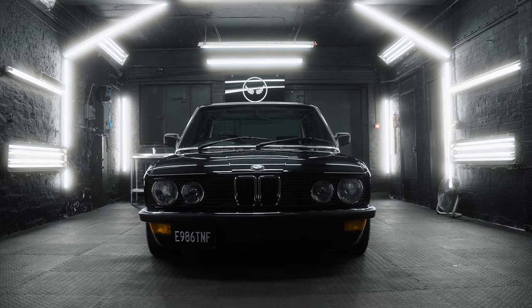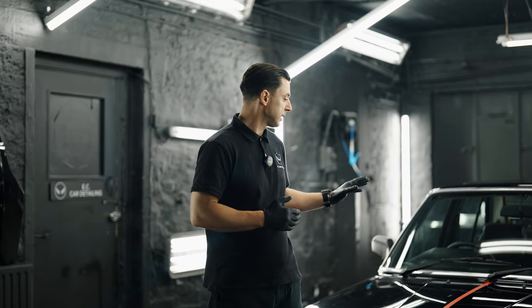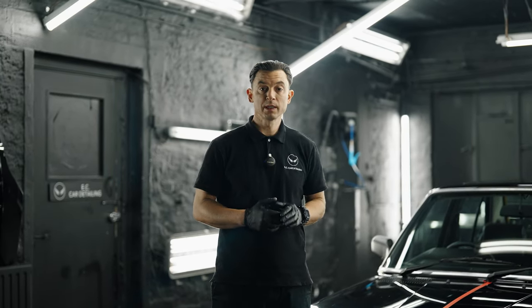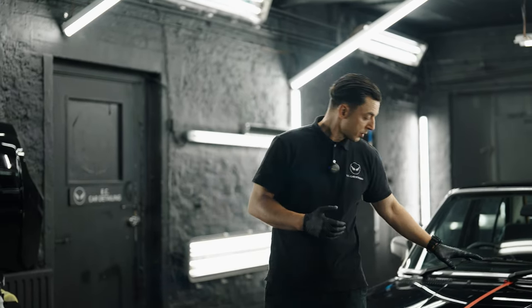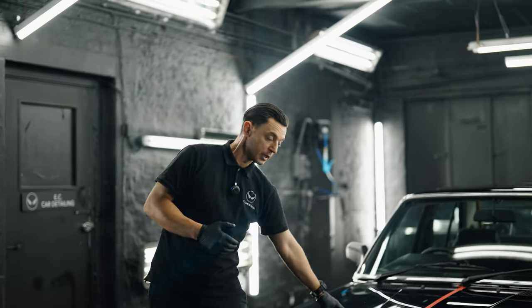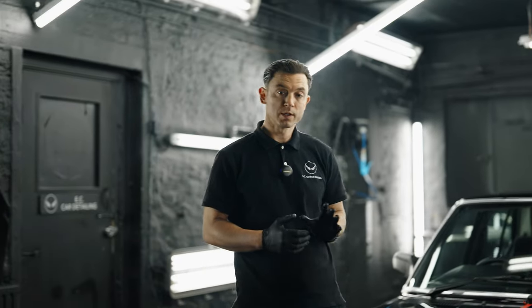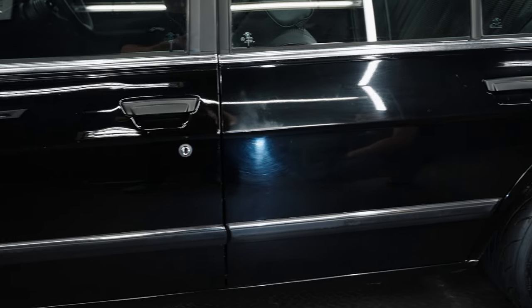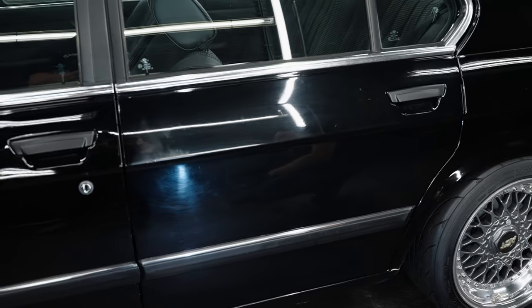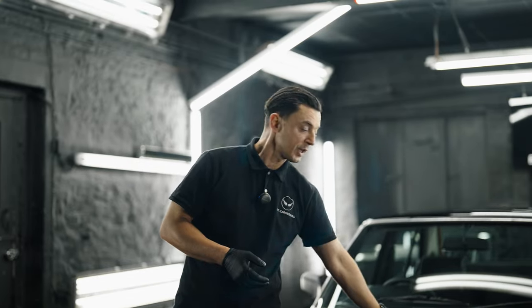This is from 1987, and again this is not original paint, so we've been approaching this vehicle very carefully because we're respraying it a second time. It's two-pack paint. On the left-hand side we got about 130 microns, and because it's two-pack paint, everything — lacquer, primer — is all mixed up together. On the right-hand side of the bonnet we came down to about 17 microns.